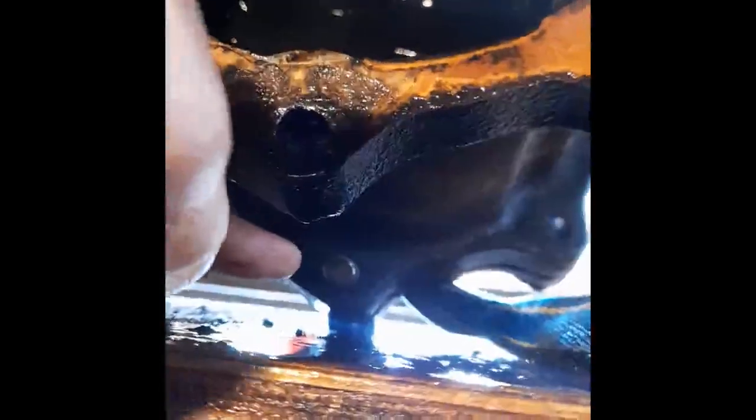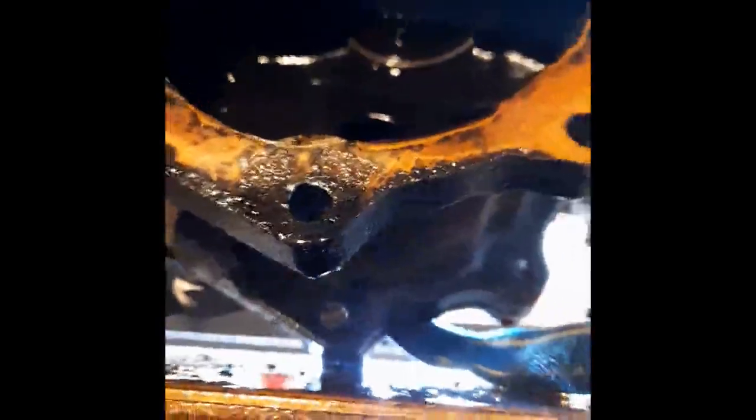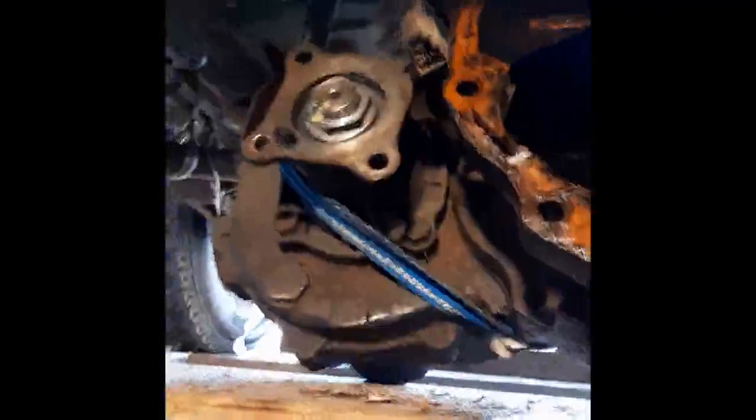The other thing we disconnected was the speedo cable. So it's actually a very simple job, although it's a heavy job — not easy. You can see one remaining piece of stud that I've got to take out — it's the bolt head end so there shouldn't be any thread in it, but it's really stubborn. I'll take the box off and worry about it afterwards; otherwise it is fairly straightforward.